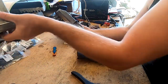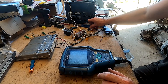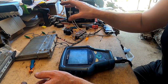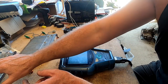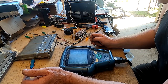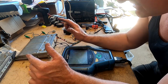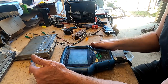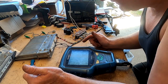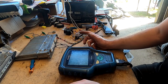So we go back to the faulty one. With the faulty one we turn it on, massage it into giving a light, and with a couple of adjustments I've managed to get some communications with the ECU. This one only has 12 codes — that's really interesting. I can still only read 11. Now I'm going to hook up the laptop and suck some information out of that one to see what's been done in there.